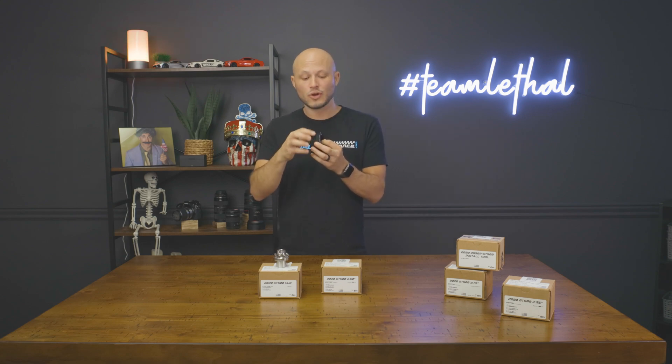And here comes Grip-Tech to save the day. Grip-Tech has two pieces of technology that actually prevent belt slippage and avoid any premature wearing of the belt. The first one is called Grip-Tech Micro — this is where they have a CNC machine remove material from where the belt sits. The second piece of technology is called Grip-Tech Weld — this is where they micro-weld material onto where the belt sits. Together, these act as somewhat of a bead lock for the actual belt.